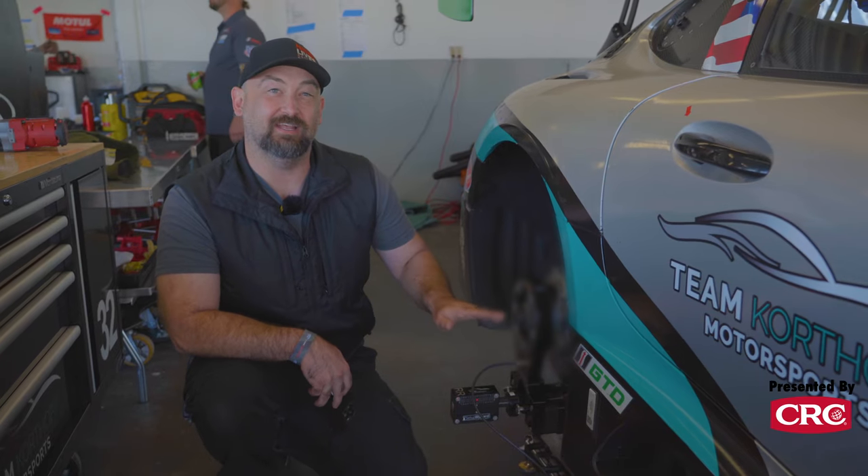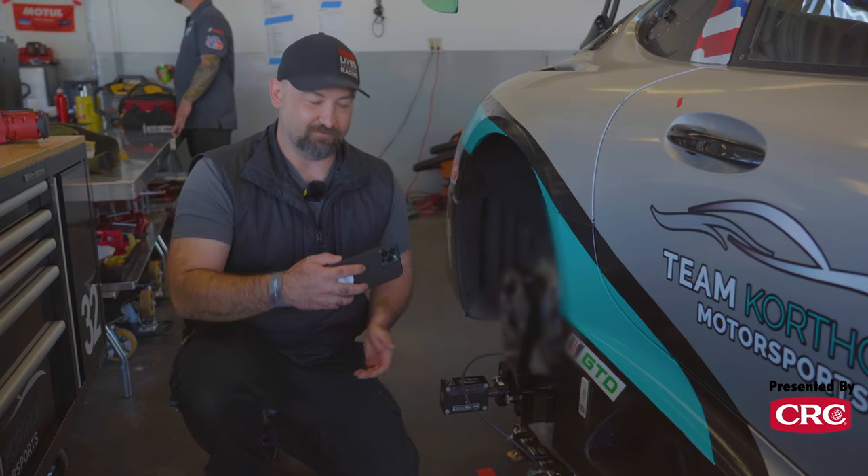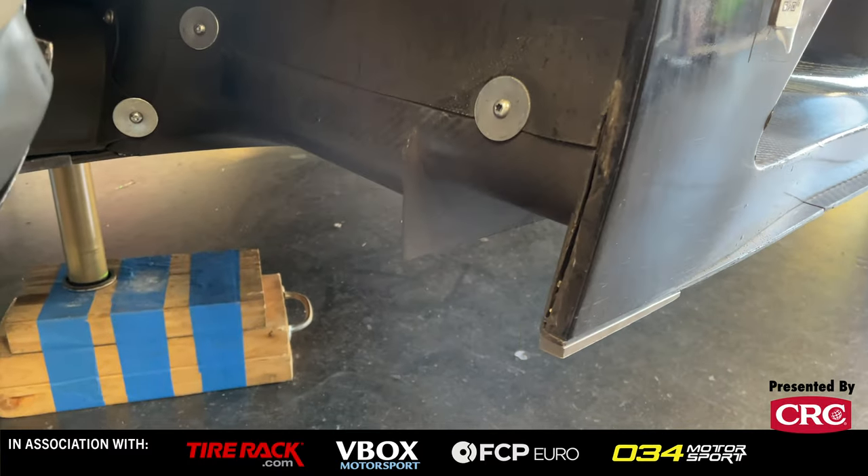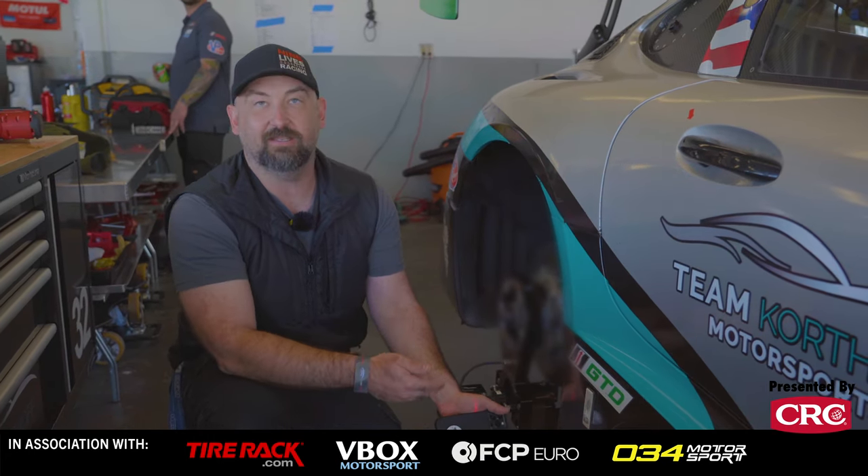The fifth and final one — these actually showed some pretty impressive results in our CFD work, and they're really easy to adapt to your own car. What they are is a diffuser that sits on your side skirt. On our car, we took a cutoff wing end — which we call mini wings, available on our website for under $40 — and put it into the side skirts. It netted over 130 pounds of downforce in our testing, and they're just a really simple way to add some really solid central downforce.